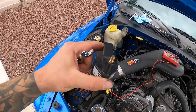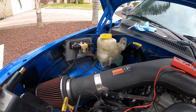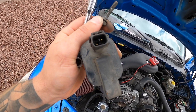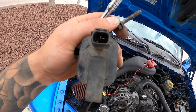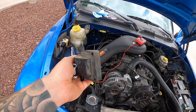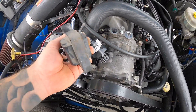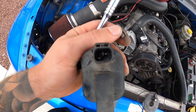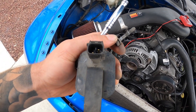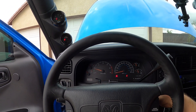We got the coil pack that I had new previously, so let's try this one. I found the culprit! When this got reinstalled the pin got bent, and since it's upside down you would never see it. I'm glad I finally found the problem. Since it's out I'm going to put in that new coil pack I had. I guess once it started banging around and bumping around, that pin wasn't making contact and that was the issue. She's alive!